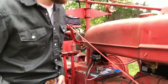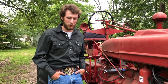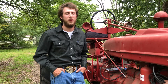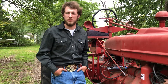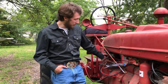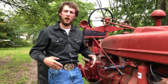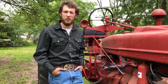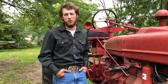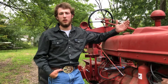We'll eventually improve on that antenna, but overall this has been a really fun project. We had a lot of trial and error this quarter — I fried my first Arduino and had to get another one. I tried to power the system off the 12-volt battery and that was just too much for it to handle. With the next Arduino I tried 6 volts, which powered the Arduino but wasn't enough to close the 500-amp relay needed to activate the starter. I put it on 9 volts — initially one 9-volt battery — and it worked well; we got three cranks out of it before the battery died. So we wired four batteries in parallel and got about 20 cranks off of them so far, still going strong. Four batteries holds a reliable charge, which is exactly what we were shooting for — we wanted a system that can be used over and over again, reliably every time it's called upon.